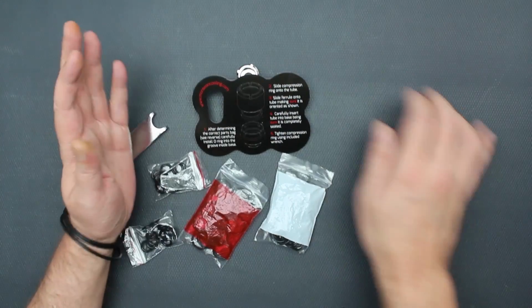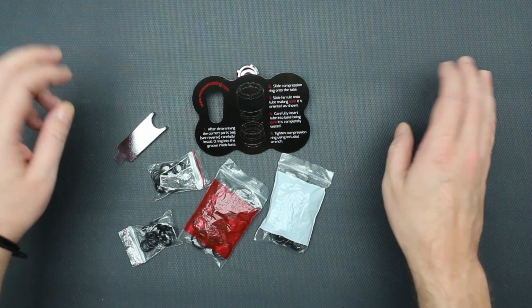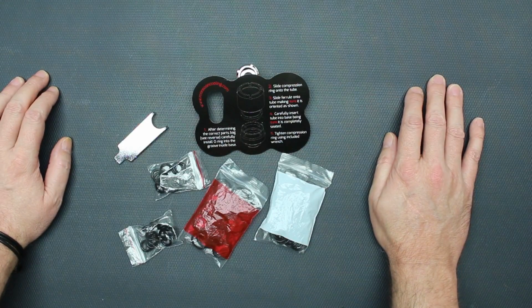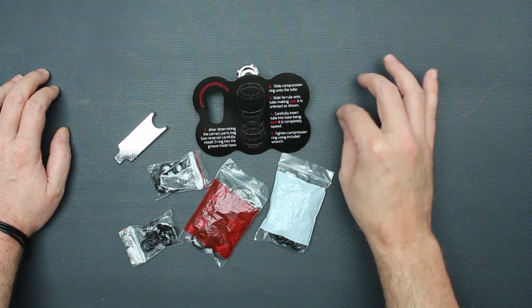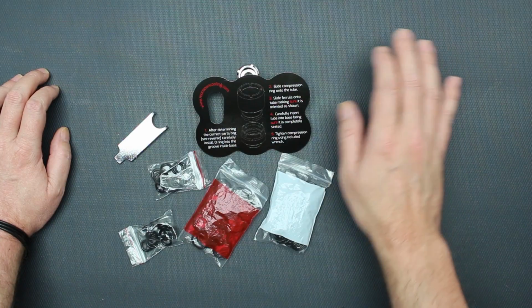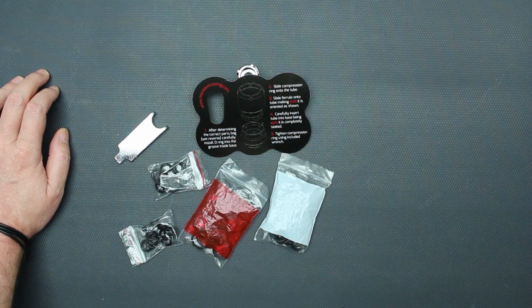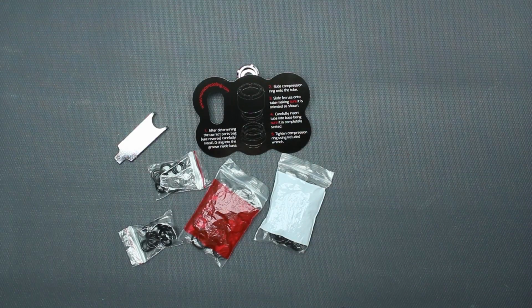If you reach inside and you're unplugging a SATA plug or something like that, or a Molex, and it pops loose and you hit a tube and it pulls it out, water pours everywhere. It's just, for obvious reasons, not a good thing. So that was the primary goal with the new revision of our economy fittings, was to really improve the resistance to pull out. And how you do that is basically looking at the difference between soft tube and hard tube.